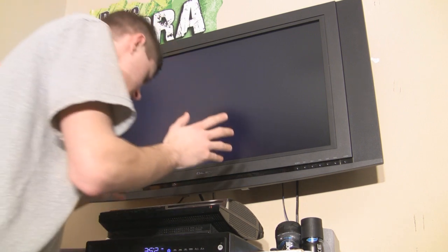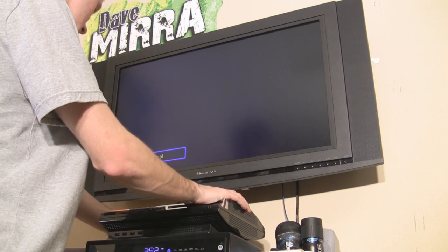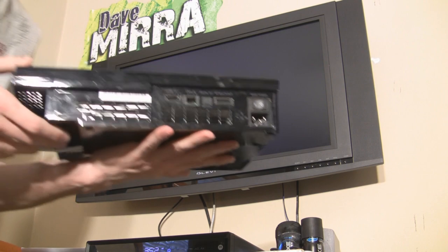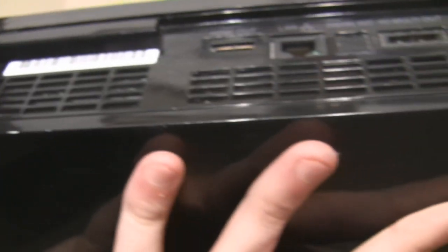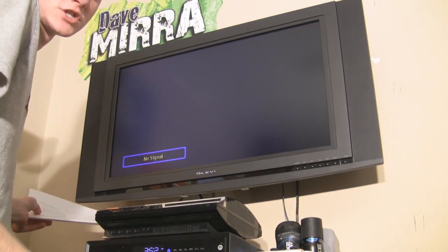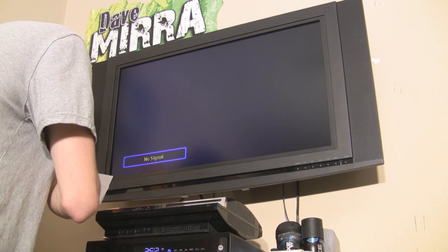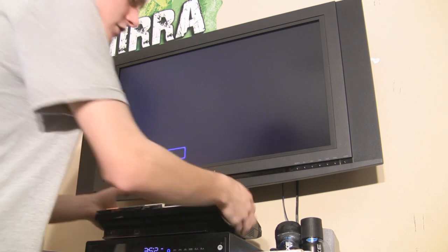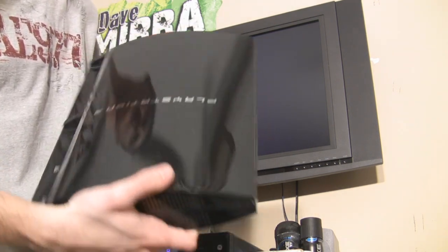Now that I'm over here at the PlayStation, let's go ahead and get started. First, unhook it or turn it around and take a look so you know which model you have. There's going to be a sticker right here on the back. You can see this one ends in C-E-C-H-A. I'm going to look at the list here — I also have this on my website, I'll have a link below. C-E-C-H-A-001 has a 256 megabyte NAND. So we know it won't work on this PlayStation. If I tried to flash this firmware onto it right now, it would break it and I would no longer have a PlayStation.